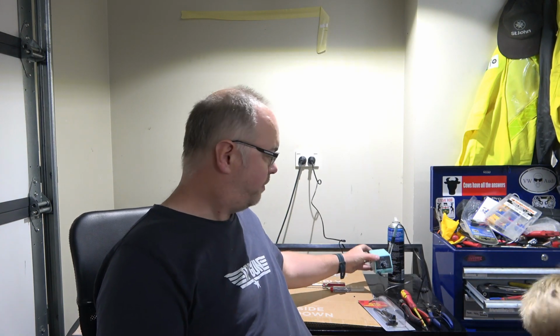You do need a decent soldering iron. I had to go and pick up a little one that's small enough to desolder surface mount components and resolder conventional through-hole components onto surface mount boards, which again sounds complicated. If you've never done it before, find something to have a trial run on and solder it on. Hi Charlie. So yeah, we'll stick this back on the car, make sure it still works, and we're done.